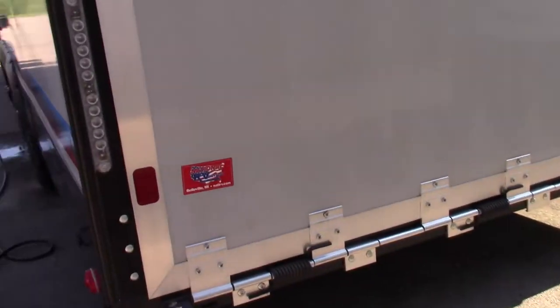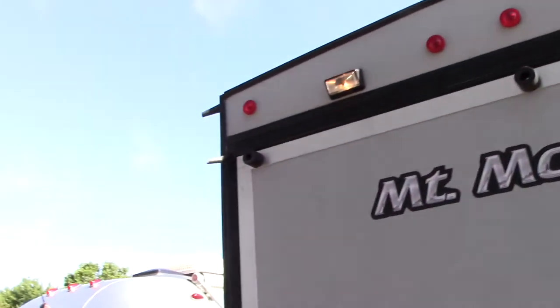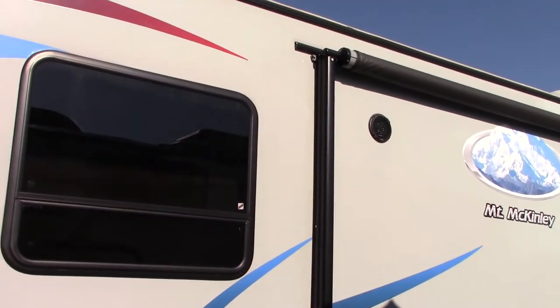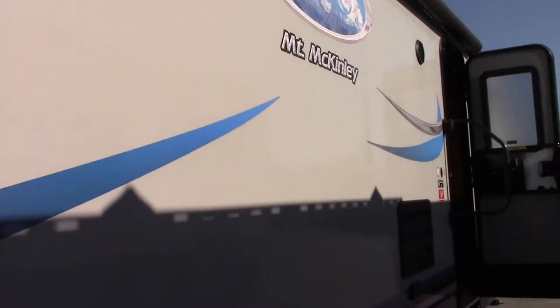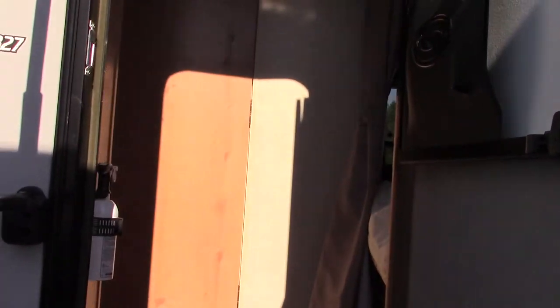Your doors come down just like you'd expect — we'll walk through that when you get here. Now remember, you have to inspect the roof of your trailer at least three times a season: spring, fall, and once in the middle of summer. Check all the sealing on the roof and make sure there's no cracking or separation starting. If you do see that, make sure you get it taken care of. You're just protecting your investment and keeping it nice and dry.